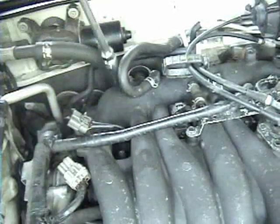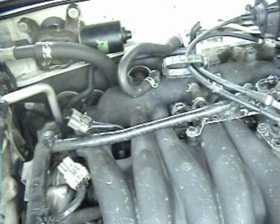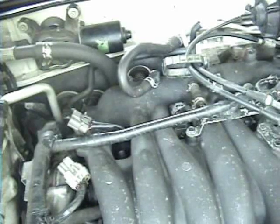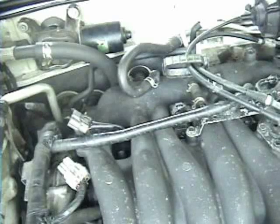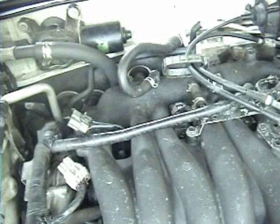Put them back in. When you torque them down, you use a torque wrench if you're not familiar with the feeling of tightness, really. That sounded kind of wrong. Or, if they're new plugs and you have the crush washers on them, get them until they're snug, pretty much. You'll feel the crush washer crushing. And then maybe a quarter turn, if that. Just be gentle. You don't want to strip the threads out in the head, because that would be a bad thing. Now put them back in.